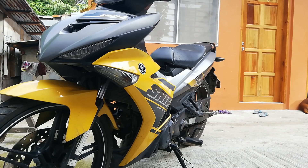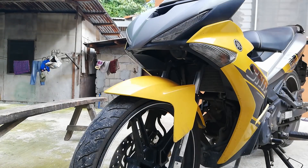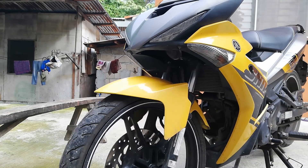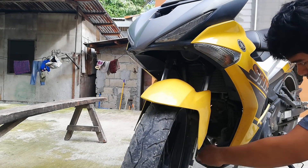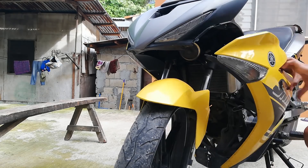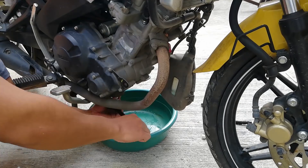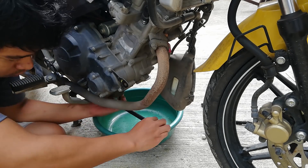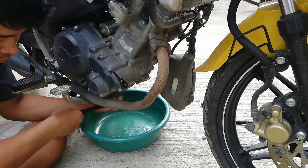Now let's get down to the parts that need to be removed. First of all, you have to make sure that your motorcycle's leg shields or side fairings are removed when doing this operation. So we have to take the right and the left cowlings. Secondly, it would be convenient if you do it during your change oil operation.